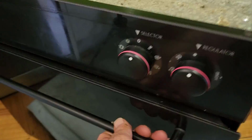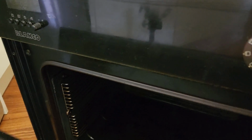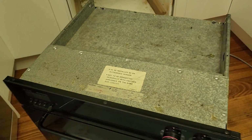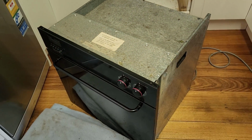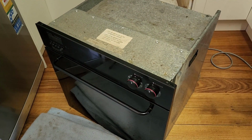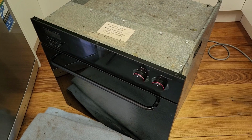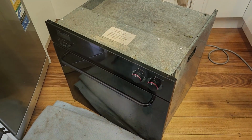The screen at the back of the oven here, if we can get some vision in here, went together well. But again, that little mesh screen over the grill at the back was a little loose on the clips, so maybe that was just oscillating, giving us a sort of sick cricket sound. But I'd like to think that it was the bushes in the motors and that I fixed it, but really we may never know. The important thing is though, hopefully we can have roast pork tonight and it won't carry on for an hour afterwards. I'll report back to you soon.